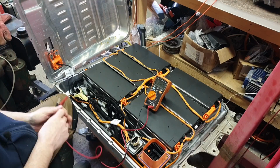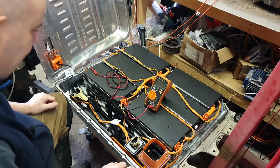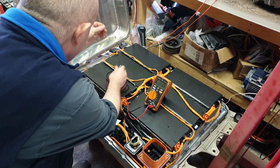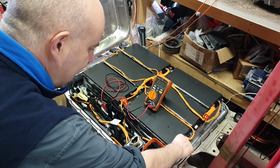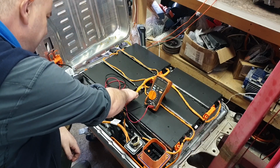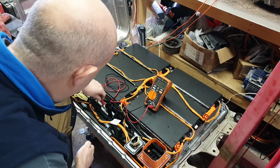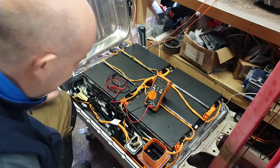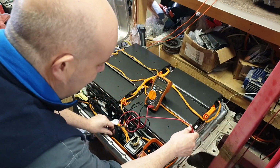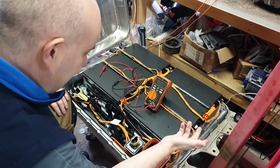Well, this battery is not earthed to the earth that we're currently sitting on anywhere. So, for example, if I was to do something incredibly dumb, like say, take a metal probe, stick it into the battery negative here, with my bare hand on it, I'm not going to get a shock. Okay? In fact, I can do this anywhere on the battery with one hand. I can touch any terminal that I please with one hand, and I'm not going to get a shock. However, it becomes quite dangerous if, for example, let's say I was measuring something down here and then I'm going around probing here, and there's any possibility that that then comes into contact with both of my hands. So don't do that. Only use one hand.